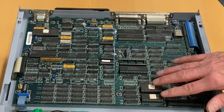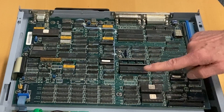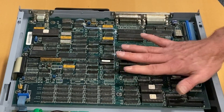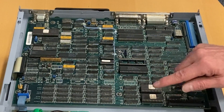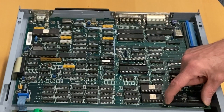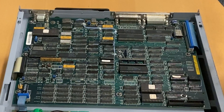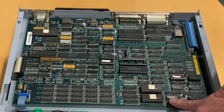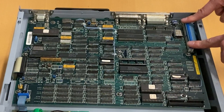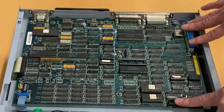Moving down here we have the BIOS. This one is the high BIOS and this is the low BIOS. The current version in all three computers is version 2.04. This chip is combined with this one for the expansion unit — this is the 16-bit extension and this is the 8-bit for the expansion card, driven from here.